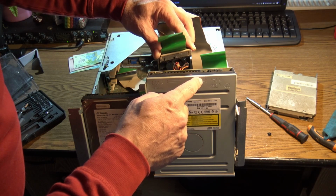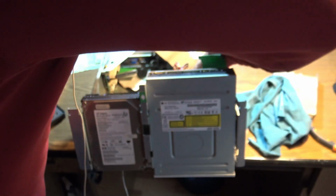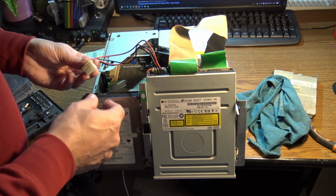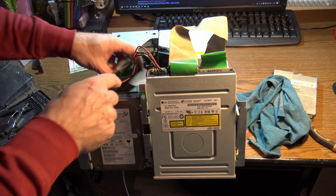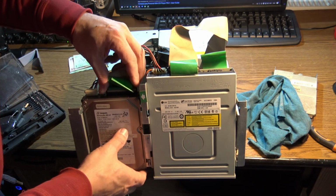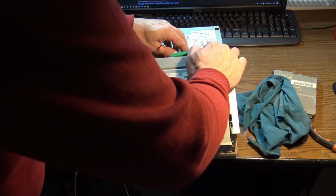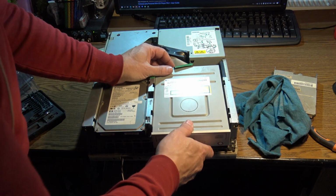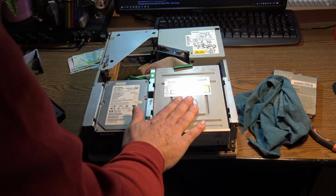Obviously this one, it's okay, it's set like master. It can be with the second port here. Power is here. The other one goes to the hard drive. It's also master to the other IDE port, and we are good to go for now. Back in place. Very interesting mechanical stuff here. Well, this one should stay like this for the sake of experiment.